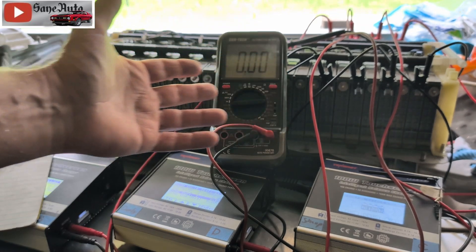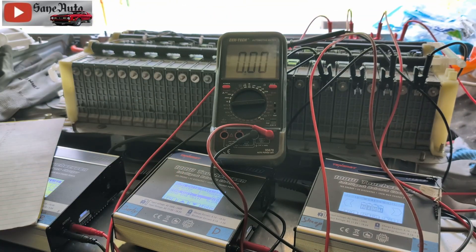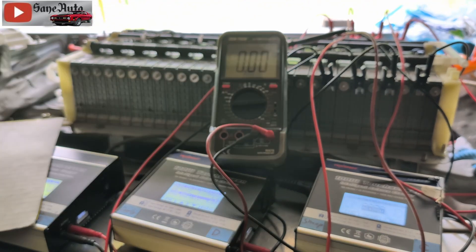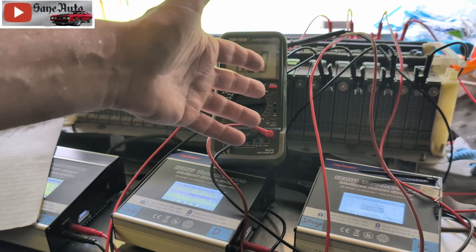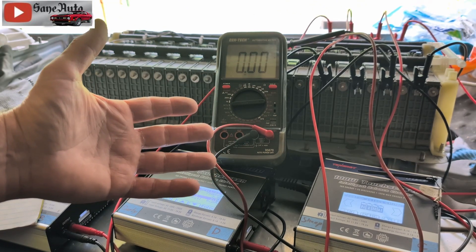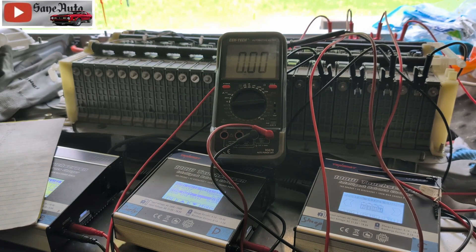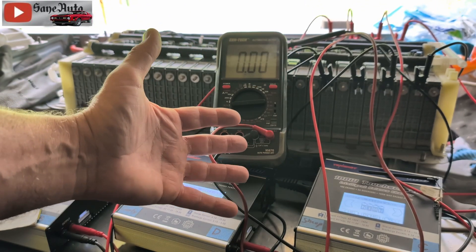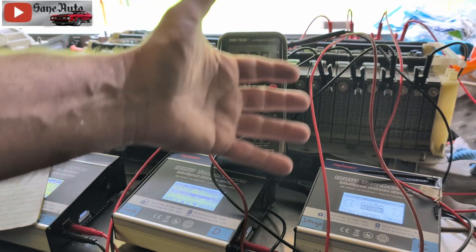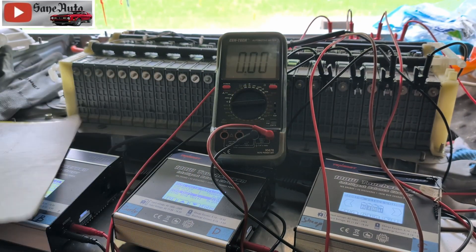These have a really high capacity after only one cycle. After doing a bunch of these packs, I don't think voltage is a good way of determining the capacity or health of a module. It doesn't have anything to do with that — it has more to do with the state of charge. Your state of charge has to be pretty low before it starts showing up in the voltage. Now, if the capacity is so bad that when you charge it up you can't get the voltage over eight, then yeah, it's bad — but that doesn't mean high voltage means it's good.